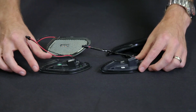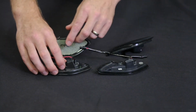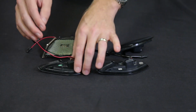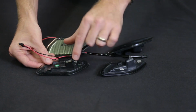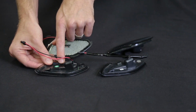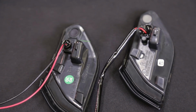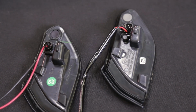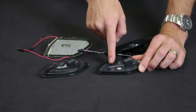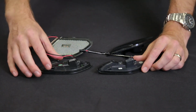You can also tell just by looking at this mold, the way this plastic piece was molded. On the last one I said it feels cheaper. This one doesn't necessarily feel cheaper, but it definitely looks cheaper. On close inspection, you can see all kinds of different parting lines and lots of different sizes of text. They do have an RH indicator here and a couple of serial numbers, but no material markings. Versus the Diode Dynamics one, which has a nice, clean Diode Dynamics line. Of course, that's not required and nobody's going to see that, but it does say a lot about the quality of the tool and the overall quality that this part was made with.